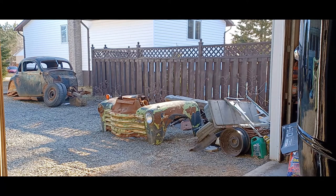And she's in for the night. Okay, so there you have it. Even though we had miserable weather, I was able to work around it. When it rained, I wet sanded and buffed on the car and got the whole body done. So that's a big one out of the way, big job. And with the one sunny day I did have, got the fenders primed. They've all got to be blocked again, primed again, and then we'll see how they look. They may need two more blockings. I don't know.